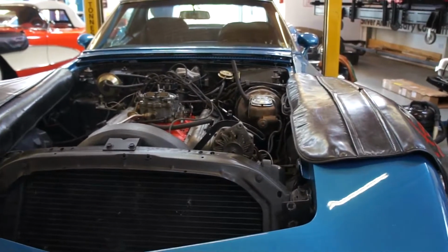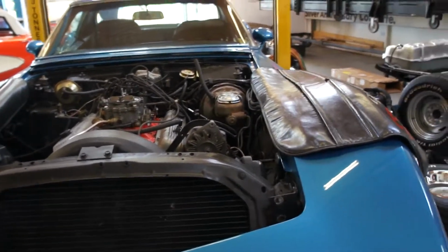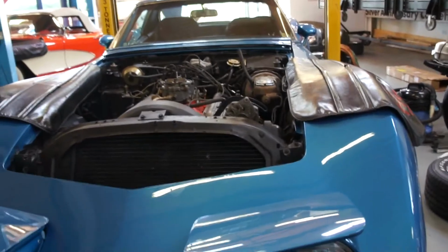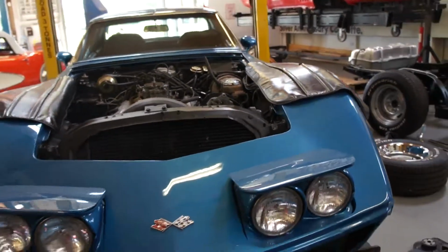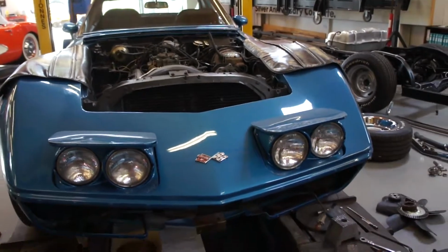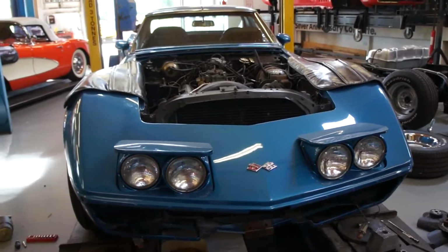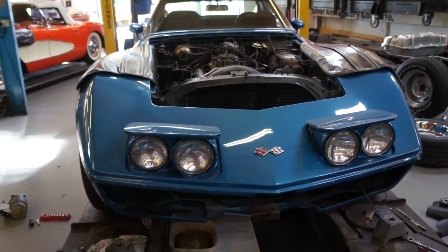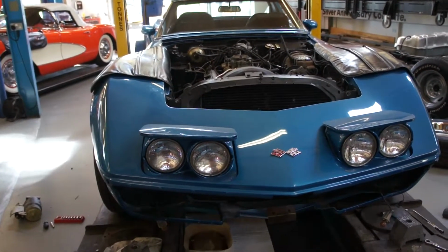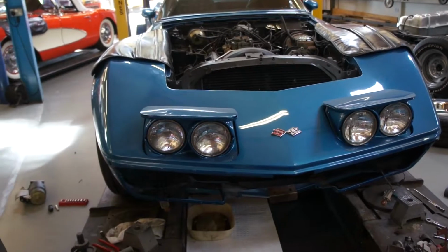So it's obviously everything's been made to fit the crooked chassis, and like I said to you on the phone, our concern is that when we put a straight chassis on this, we're going to wind up with fitment issues on the front end. But if it's minor, then we can get around it. And with the best will in the world, these cars weren't that square anyway from factory. It's very seldom that you see one which is perfect, so you do have a bit of leeway here and there.